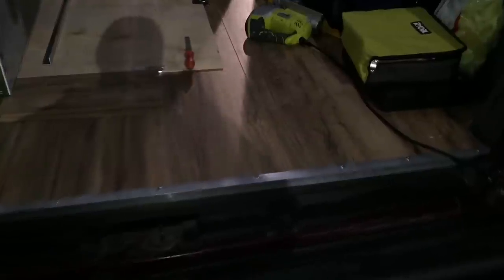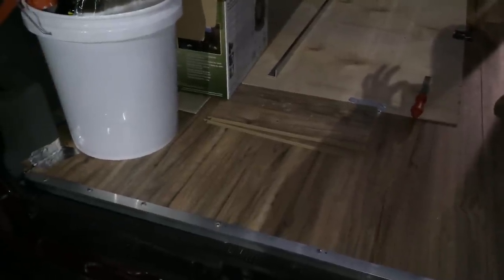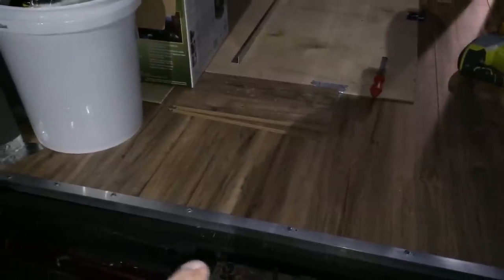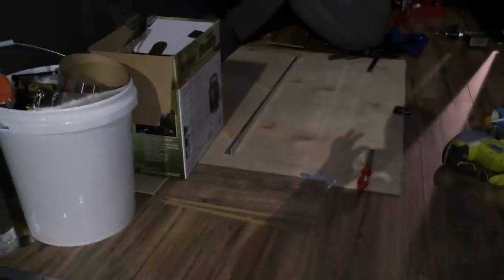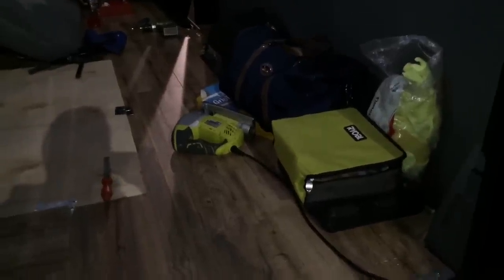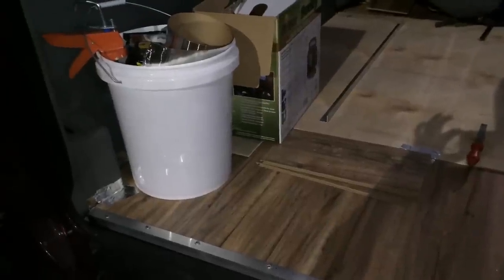Now this floor is acting as one piece. I didn't have to drill through the floor of the van to make sure that this floor does not slide, because now that it's acting as one piece, all the sides of the van — the sides are not straight, you've got all these zigzags on one side, and all these zigzags and the wheel well — all those things will keep this floor from sliding back and forth. And since we have the floor right against the walls, it's not going anywhere. It's staying here for good.